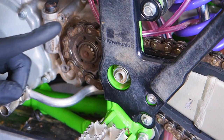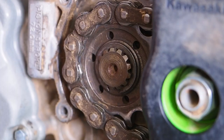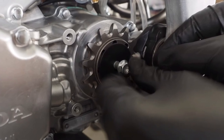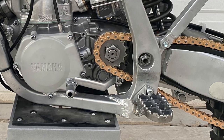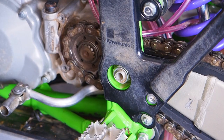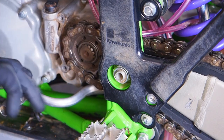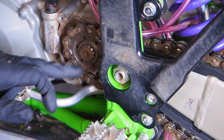Tip one is to start with the front sprocket first by taking the nut or bolt off. On the 1999 KX250 there's actually just a circlip that I need to pop off, but most models have either a bolt like the Hondas or a nut like the Yamahas that you need to remove first. The most important thing is to never put the bike in gear to remove this nut — always step on the rear brake while the chain is still on the bike. You never want to put the bike in gear because you could destroy the gears on the inside of the motor.